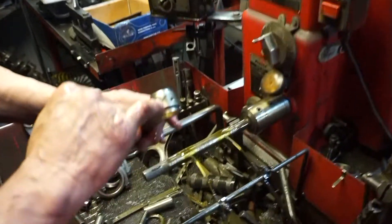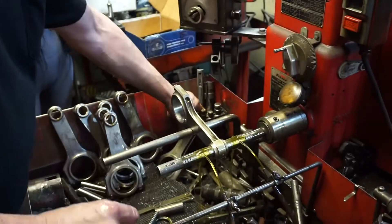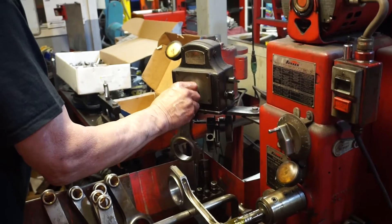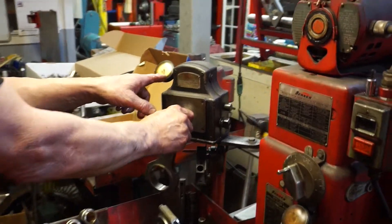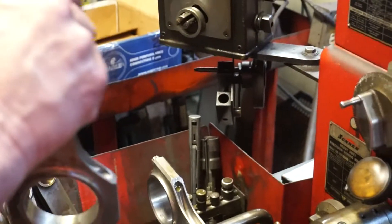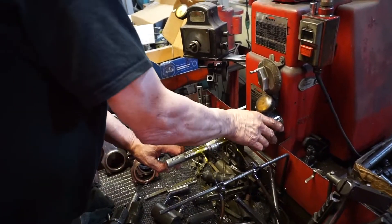That one there, he called me and told me about it, but he marked it with an X. For whatever reason that one cut two-thousandths bigger than what the others did, so you were down in the four-plus-thousandths range. And that's why I purposely had him do that — in case there was any kind of variation, I could still fit it the way I wanted it to be.